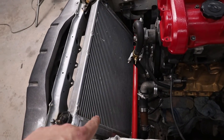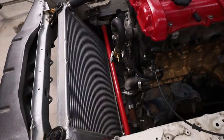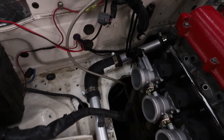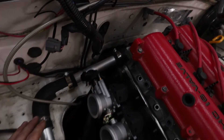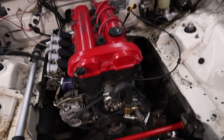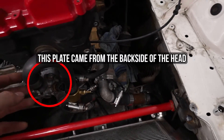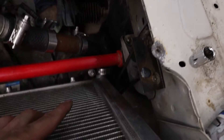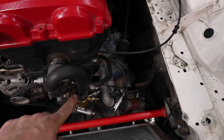Obviously it's pretty crude and archaic-looking, but it gives me an idea of what I need to do in the future for a nicer piece. For the cooling system, I took the radiator and angled the top forward a little to help air come up — I'm going to do some hood louvers to evacuate lift and hot air. This is the poor man's coolant reroute. I spent about 20 bucks for all the aluminum tubing, 8 bucks for the housing, and maybe another 20 for the hose. I just looped it around, put the housing on backwards, and ran the hose under the sway bar to the radiator.